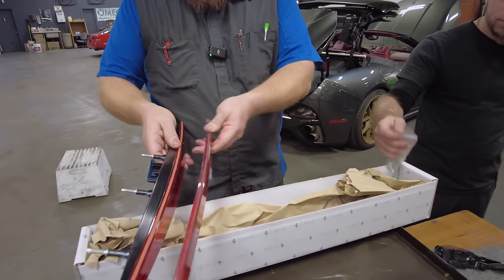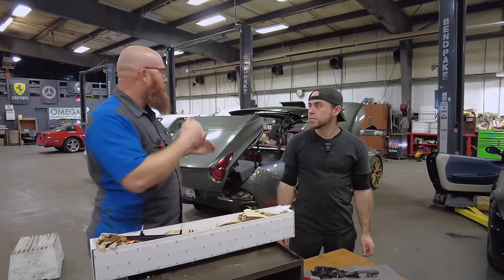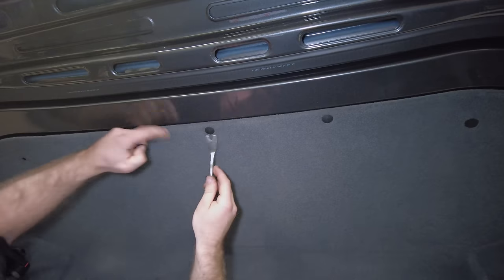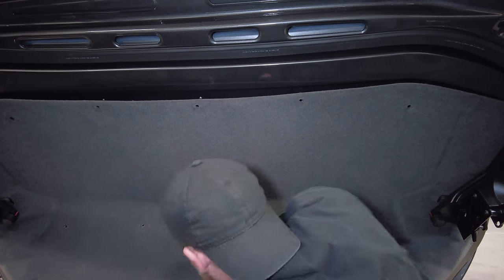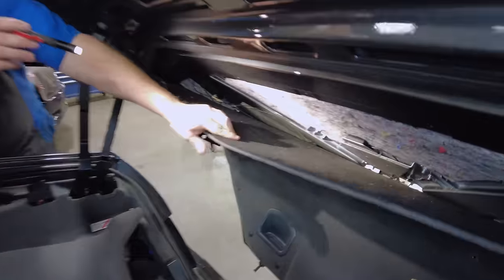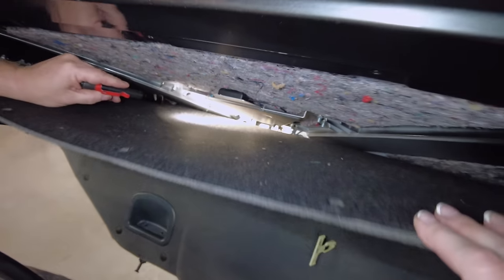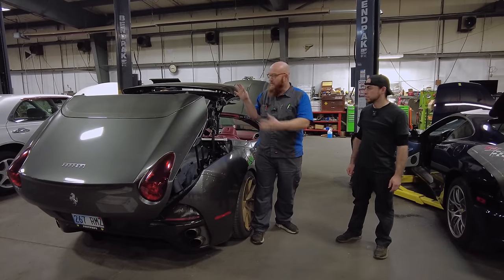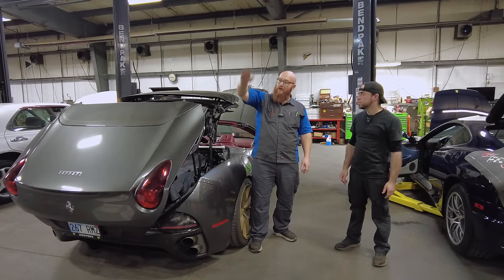The old lens simply fell off its housing — the whole brake light unit didn't fall out, just the lens. To show how to access it, Danielson pulls down the trunk padding to reveal the spring-loaded nuts — four of them along the frame piece — that hold the unit in place. In the current position with the top disassembled it's difficult to access, so they'll wait until the top is done, remove the carpet piece, and do it correctly with the trunk open the proper way.